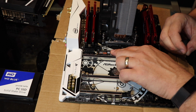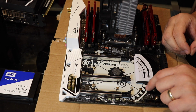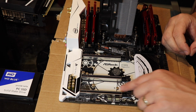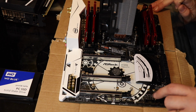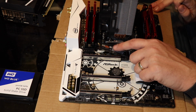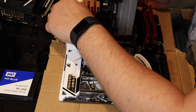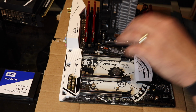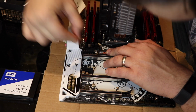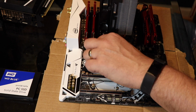Then you put it down, and it lines up. Some of them are a little shorter, like you'll see these little spaces. Some of them are a little longer. Now, if your motherboard doesn't have onboard Wi-Fi, you can actually buy Wi-Fi cards that install like this for the M2 as well. My motherboard happens to have onboard Wi-Fi. You can tell because it has these little spots for the antennas. Not all motherboards do. It's these little gold round things, the spot where you plug the antenna in.